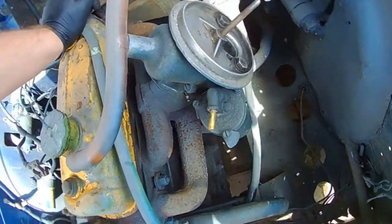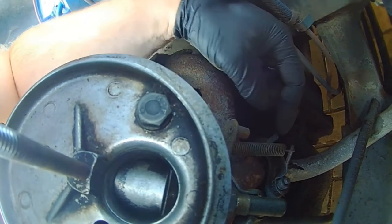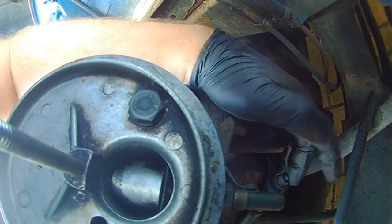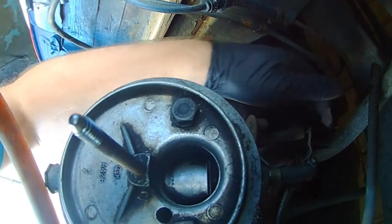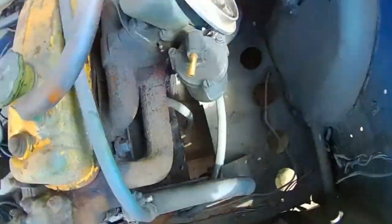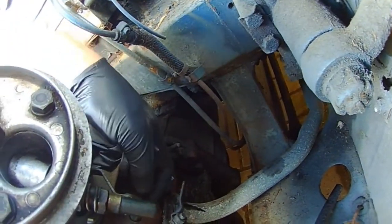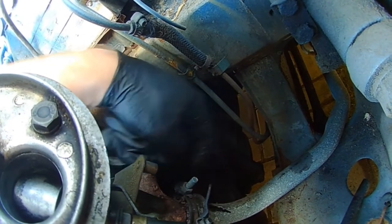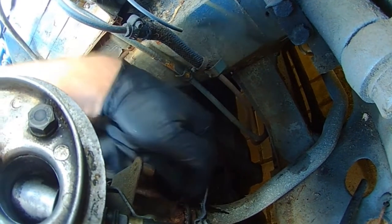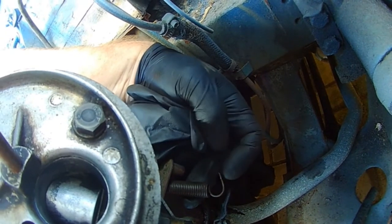Just a quick check around the car before I got into the last bolts and I'm glad I did, because I forgot to release the throttle return spring. This just hooks over this down here and then onto the return on the throttle — a pair of pliers to pull this off, and then it frees it from the bracket on the exhaust. The spring is off. It was more fiddly than I anticipated — I ended up bending it out to get it off. You can see the bracket it's held on at the join between the manifold and the exhaust downpipe. That spring will be getting replaced anyway.